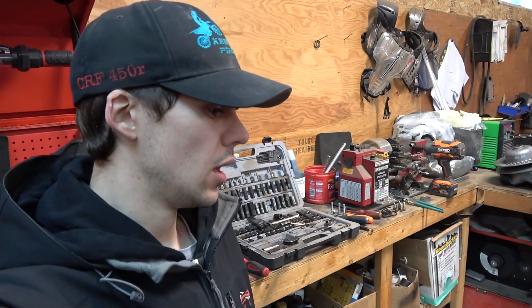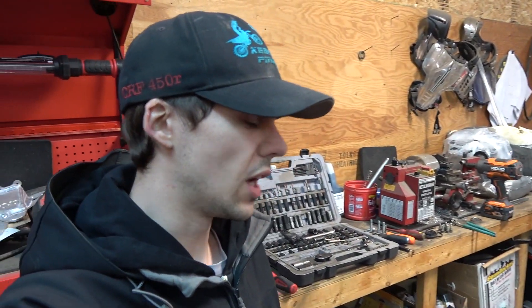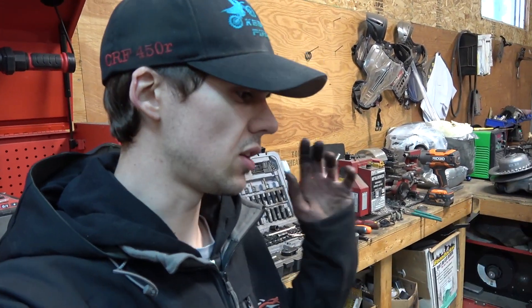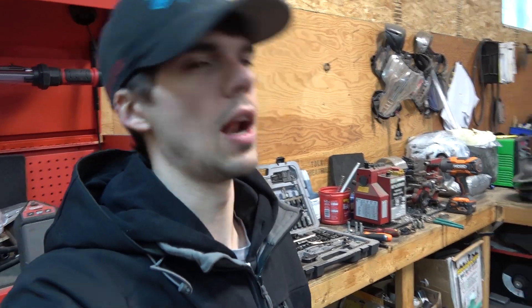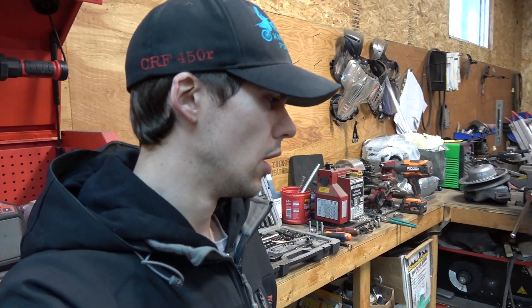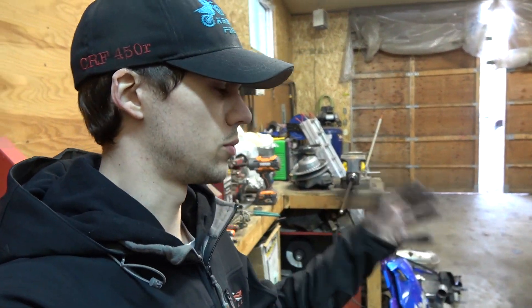Basically, this way I won't have to worry about the crank. Turbos are hard on cranks and wrist pins, and that stuff does break just as often as the top end. Also, I have the motor now. If I was just doing the top end, it would be almost the same amount of work, and I'd have to order pistons, rings, check the cylinder, probably send it away to get re-plated. The turnaround with this should be faster, and we still have some riding left this season, so I want to get it back together for a shakedown before next year.